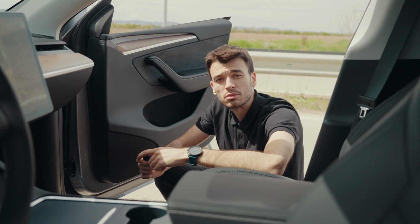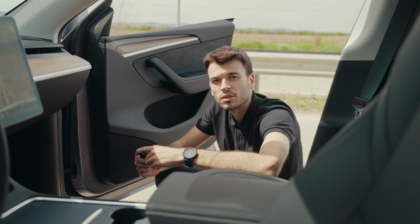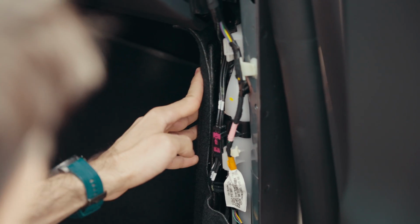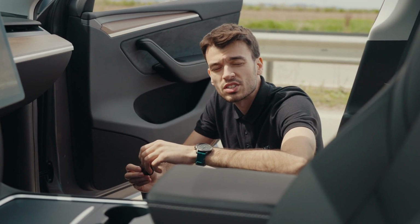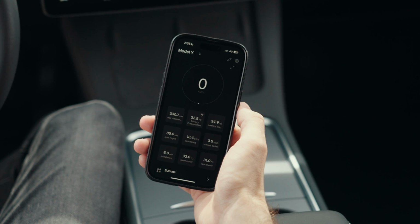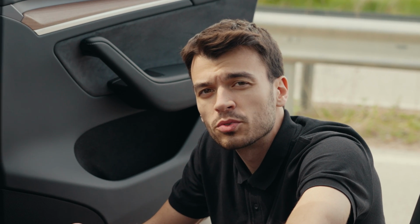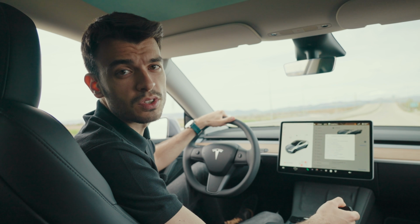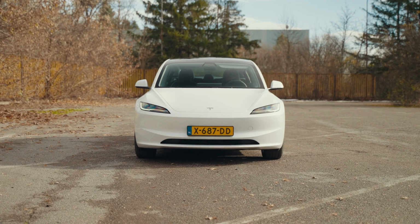The front installation might look a little bit more complex from the outside, but most of you will do it by yourself without any issues if you follow our installation videos on our channel. The good thing is that here at the front you can hide the Commander and all the wiring behind the A-pillar, whereas on the back the Commander will stick out. Another positive feature of the front installation is that we have a little bit more access to some extra CAN bus data, which on the back of the central console it is not possible. This data we will be able to turn into new features. I'm talking about new statistics, new smart actions and some shortcuts that we will announce in the future. Be aware that front installation is available for those cars that have AMD processor rather than the Intel ones, as well as the Model 3 Highland.